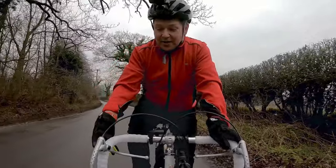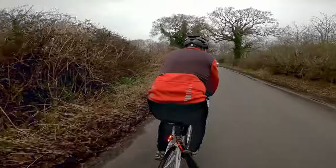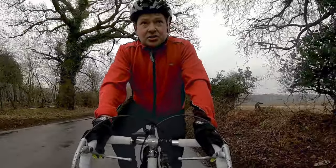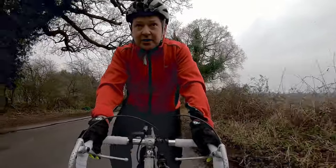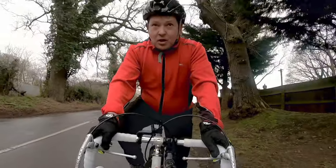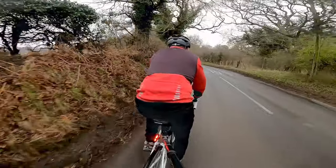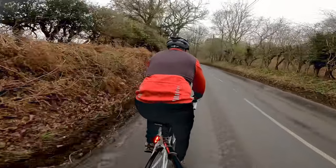The headset bearing feels great on this bike. Handlebar tape is nice and comfortable. Front brake works perfectly. I've put reasonably cheap tyres on this — they have got a little bit of tread on them, so they don't feel too bad. I feel quite confident in the grip. Cabling is working perfectly — front and rear brakes, shifter. Indexing is perfect. Wheel bearings feel great. The thing is flowing along. Bottom bracket feels good. Pedals feel okay — you may remember we didn't put bearings in those. A couple of comments said the caps came off, but trust me, they did not — we tried, we couldn't get them apart.